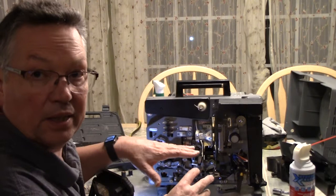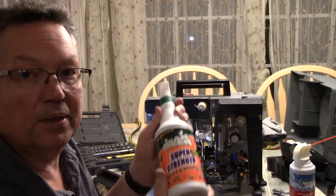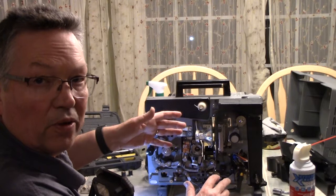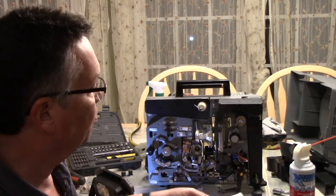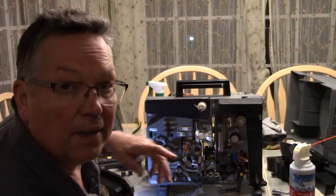We've cleaned the machine. I went through it with this stuff called Mean Green — you can get this at your Family Dollar, places like that. It's a cleaner and degreaser. I used it on the plastic parts and all the metal parts and got all the old grease off. There's grease for the mechanism to make it smoother, but over time it gets old and gummed up with dirt — so you're actually doing more damage by having old grease on there. We're going to replace it with this Teflon Lube Gel — older tube, Radio Shack brand, but same exact stuff. We'll replace all the grease in different spots, put oil on all the rollers, put the rollers back in, and get it working.